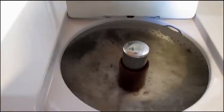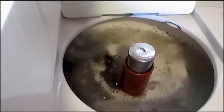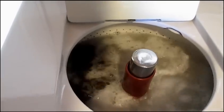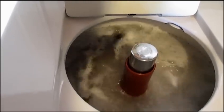I'm going to go ahead and advance the timer so we can see how this washer spins and drains. There is a perforated tub, but under that perforated tub is a solid tub, so to drain, this washer has to go into a spin and all the water goes up and over. There is a pump below that will pump the water out, and the pump is running at this present time.